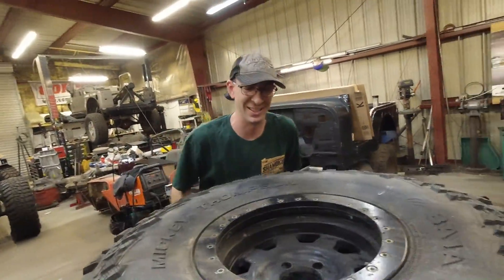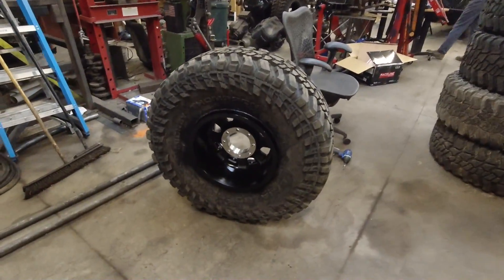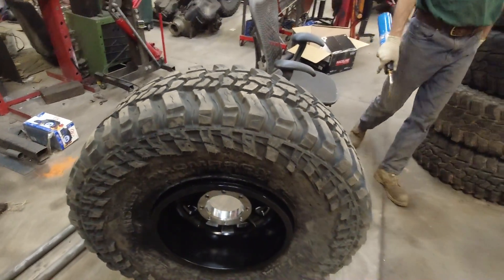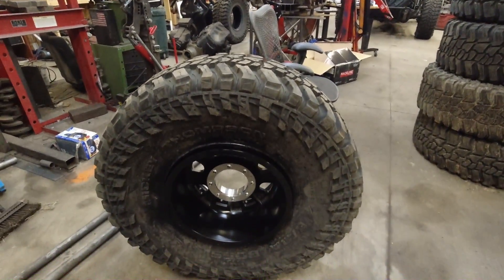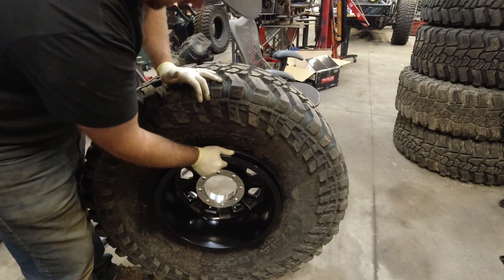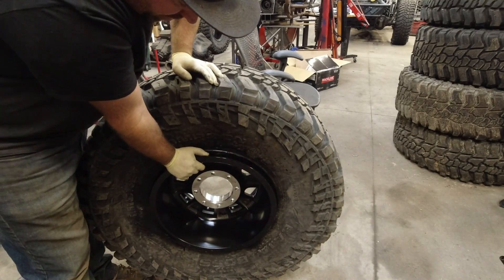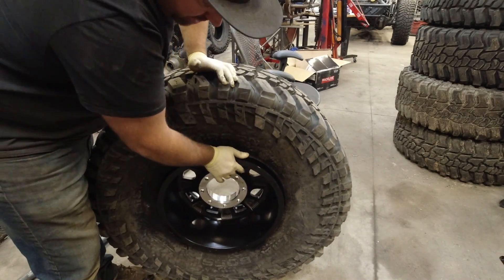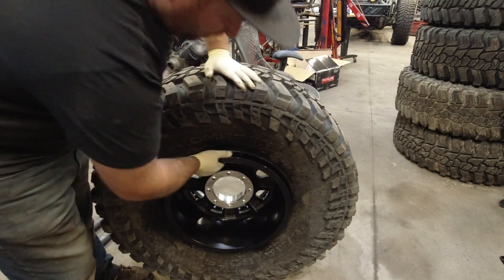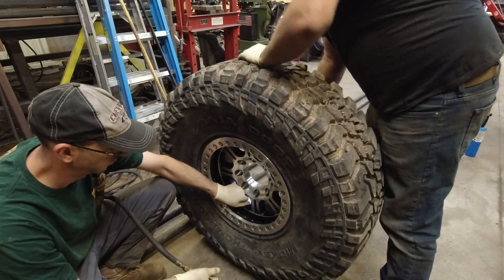The last thing we have to do is get air in this tire. One of the things that often happens is the bead is not fully set and you can't get it to take air — it all depends on your tire. With these tires the sidewalls are so thick that I'm pretty sure if we put a little pressure on it, it'll take air. So Joe is going to go on the other side and put some air in, and I'm going to put a little pressure on this side and we'll see if we can get it to seal and pop back.